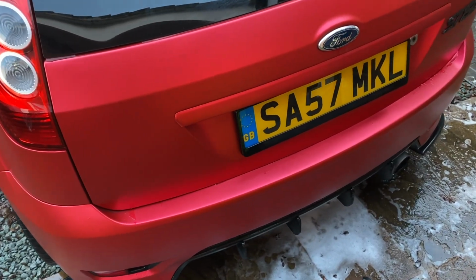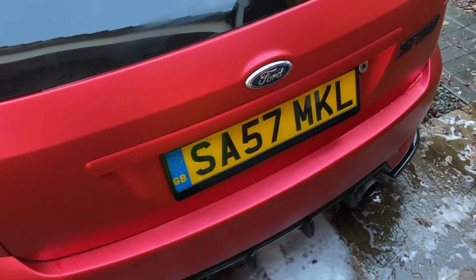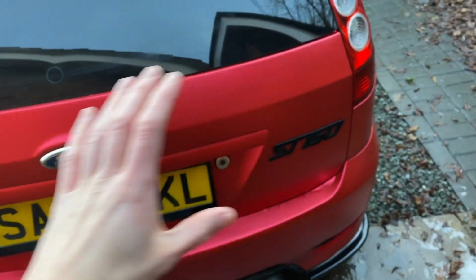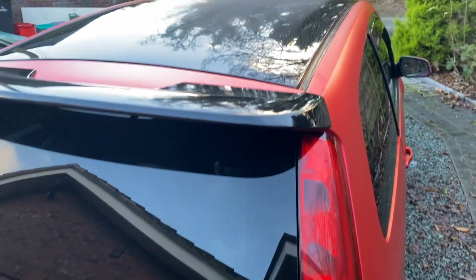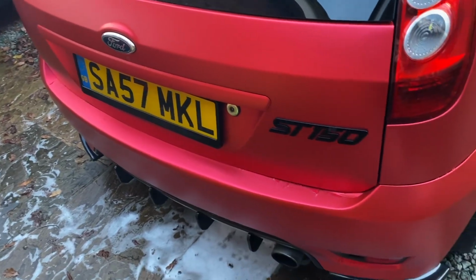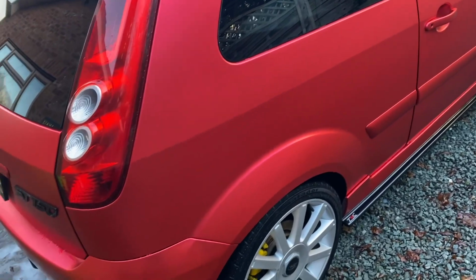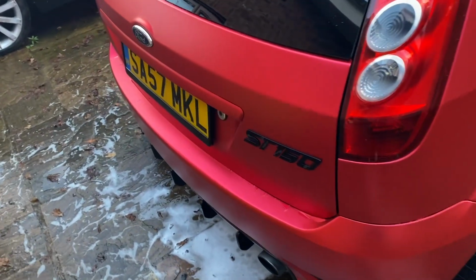And because of the temperature and not getting enough heat in it with a heat gun, it actually ripped and we wasted a whole piece of vinyl, and that kind of put us on the back foot. And that's partly the reason why we were worried about not having enough of the roof, because we thought if we can rip it that easily and it happens again, like luckily it didn't happen on a rear quarter because it's such a big piece, like 3 meters of vinyl, but it happened on the back.